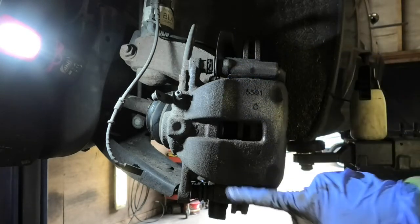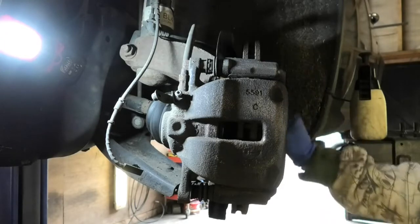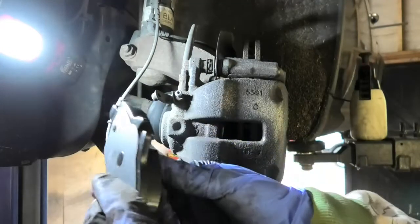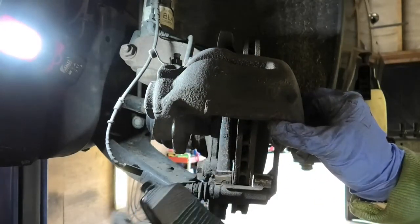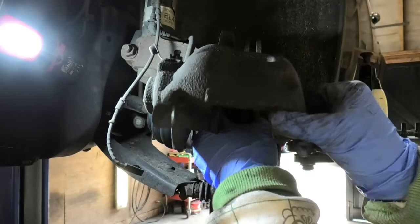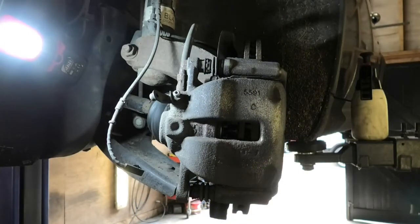Right. If while you're putting the little clamps, you get a bit of copper grease on your disc, you can just turn the disc and just wipe it off, obviously. I saw I got a little bit on this end, so just wipe it up. Now you can get your pads. That's the pad where this is the side where the sensor goes in. The new sensor will go in there. So these bits go on the little rail parts of those clamps that we just cleaned. Okay, they should just slide in fairly easily.